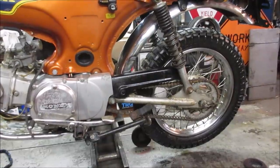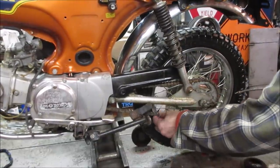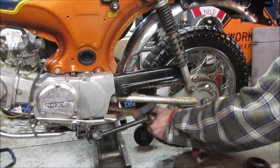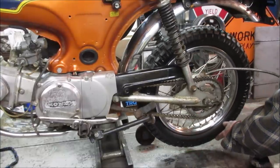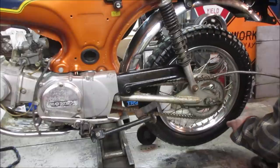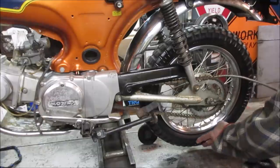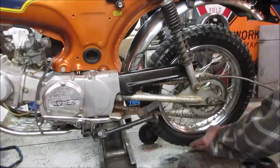So, going to take that back wheel apart? I really don't think we need to. We'll keep an eye on it in the chain. Although it's rusty looking, I don't see any links that feel bound up or anything. So for now, maybe we'll just give her a really good lube and let her spin around. If I find that it has some issues, we'll deal with it. The sprockets look good. Mostly it's just whether the chain will have any binding links on it.